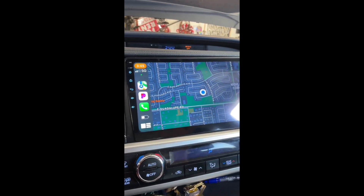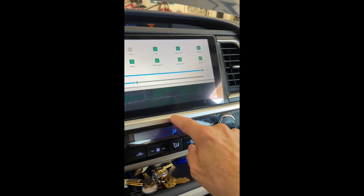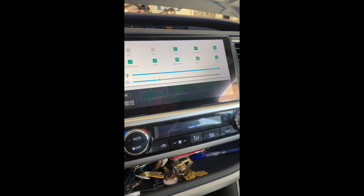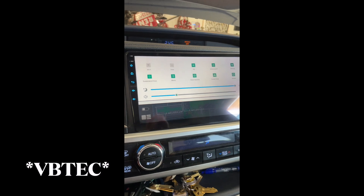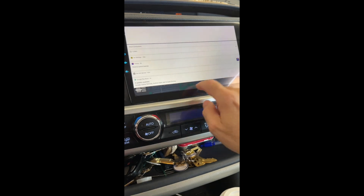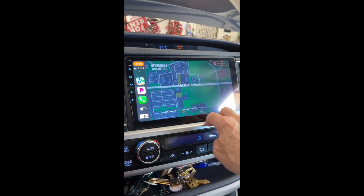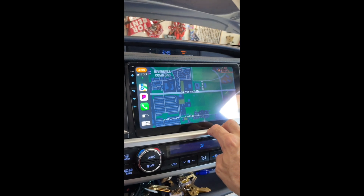The other issue: I was having trouble connecting partly because I didn't understand the house Wi-Fi issue, and I decided to do a complete factory reset. Don't do this. A factory reset will clear out some of the settings that VB Tech set up in your radio for your particular car — one of them is the type of interface. In my case the Toyota Highlander, and the other one was T-Link 5, the launcher app, which was completely gone.